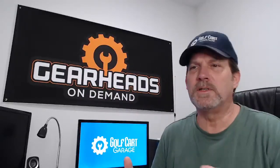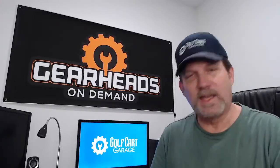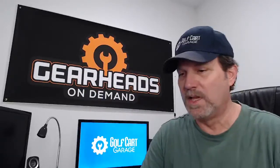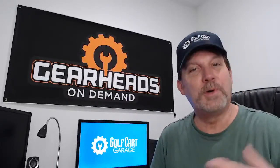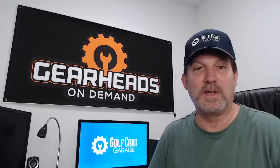You remember cordless phones like a long time ago? They used to run off nickel cadmium batteries, and sometimes those would build a memory, and sometimes it would be good to let those batteries drain completely and then charge it back up. Well, that's not the case with golf carts. So put it on charge. It likes to be fully charged. It would rather be fully charged than in any other state.